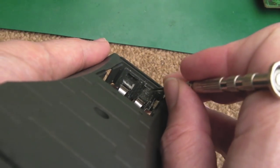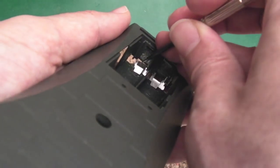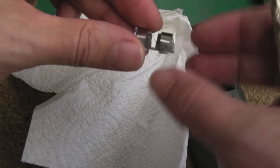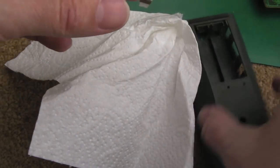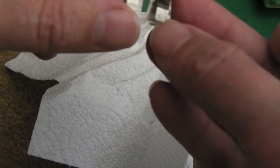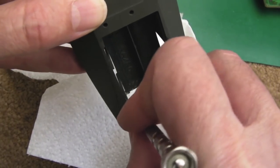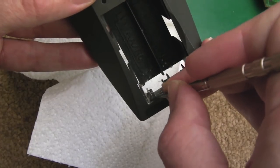In order to get the battery contacts out of here, you can just push from one side at the top, then the other side — you can see it edges out bit by bit and then that whole thing should come out. Oh god, that's awful — I've got crystallized alkaline all over my fingers. You may need to replace these, but it could be hard trying to get something that fits the exact profile. They aren't too bad actually — there's very little corrosion, just light surface, but I needed to do that so I can scrub down in here and get all this crusty stuff out. I'll get in the sink with some soap and water and a scrubbing brush.